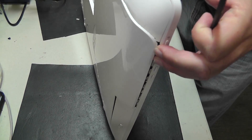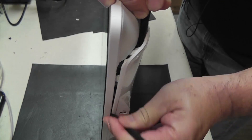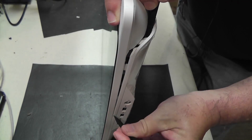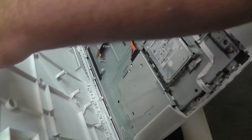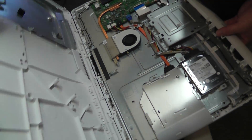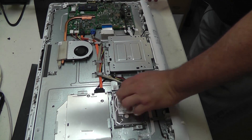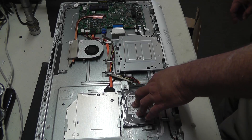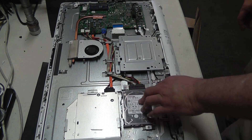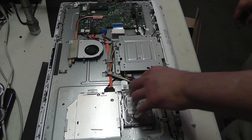It's coming off that side, let's work on this other side. There we go — and that exposes the hard drive, which is actually a 2.5-inch hard drive. The hard drive could be upgraded to an SSD easily without any special brackets or caddies or anything, which is good.